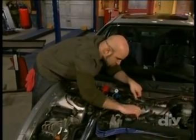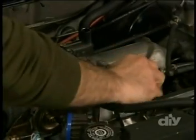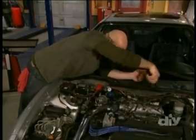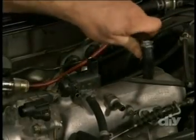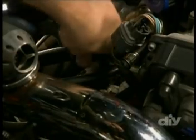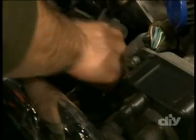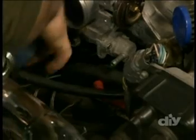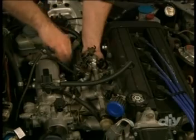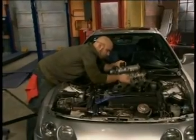I start by removing the three airlines on top of the engine: the first runs to the fuel pressure regulator, then the big crankcase ventilation line, and the fast idle or cold start valve vacuum line. The last vacuum line to come off is the one on the back of the intake manifold — it's for the brake booster. Next, I remove the two coolant lines on the throttle body, the one that attaches to the idle air control monitor, and the two coolant lines on the passenger side of the intake manifold. A few drops of coolant leak out, but since I drained the radiator first, it's no big deal. I disconnect the fuel return line, then use a ratcheting wrench to remove the nuts and bolts from the intake manifold, and carefully pry the old intake manifold off the engine.